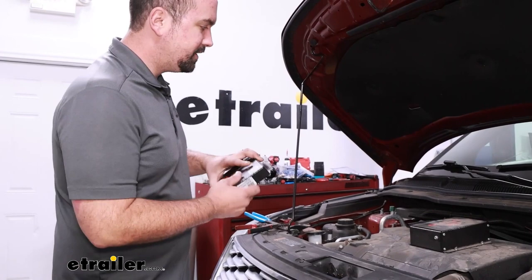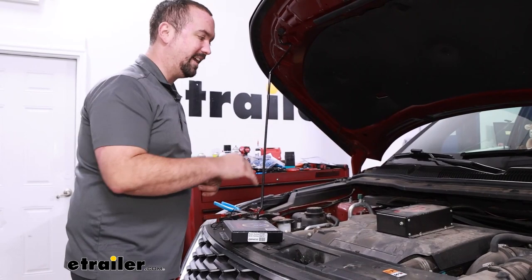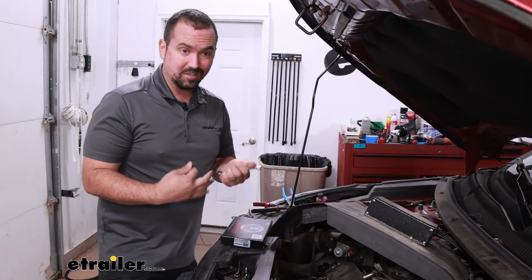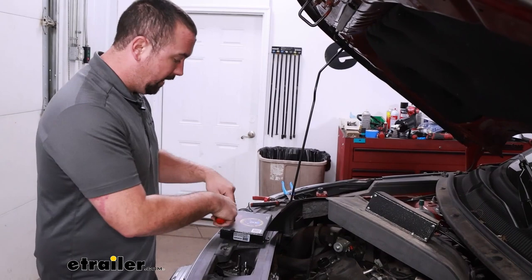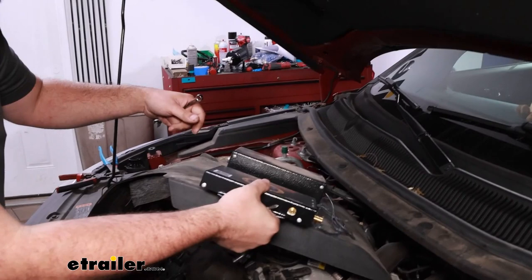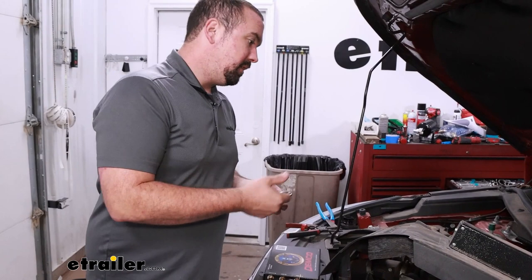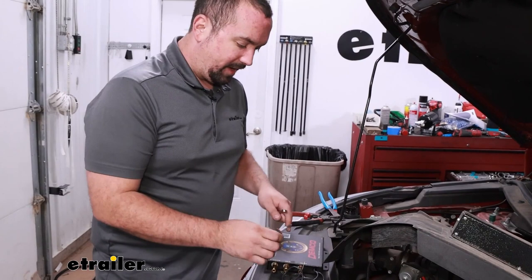The first thing I'm going to do is take our old unit off and mount it up in the same exact spot — that way we have all of our wires and air fittings right there for us. Now depending on where your Stay-and-Play is mounted, this could get a little bit tricky if you got crafty hiding it. The main thing is all of our connections have to go into that main unit, and the Air Force One is actually a little bit smaller — about the same length but a definitely smaller footprint — so wherever your Stay-and-Play was mounted before, your Air Force One will fit.